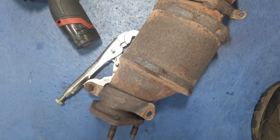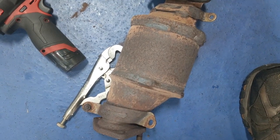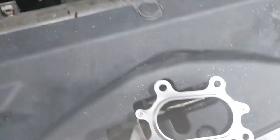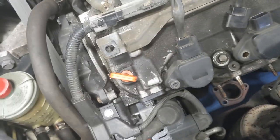I've got to see how much this thing would be worth at a scrapyard. I've also got new gaskets going on here — this one is the donut that goes down into the J-pipe, and this one goes up on the manifold. You definitely want to replace these, otherwise it's going to leak. If you're like me and you don't really carry around internal hex sockets, a T40 Torx bit will work just fine for these. Just like that — freedom.